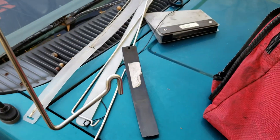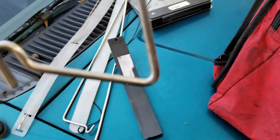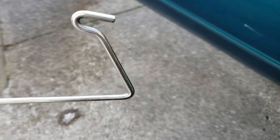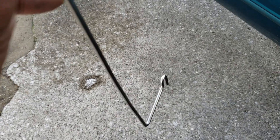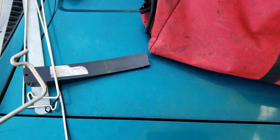This is the regular AR tool — it has the hook on the outside instead of the inside. You've got the short end and the long end. This is my favorite tool to use to get into Ford Explorers from model years 2008 all the way up to 2015. You go to the passenger side back door, slide it down, get that hook with tension, turn it to the side, and pull to unlock the door.